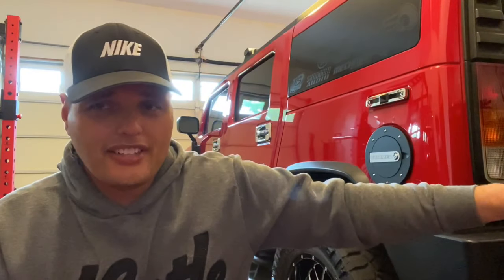I'm going to explain the process in two separate ways. The first is if you have a factory front stage — your door speakers and pillars — with an amplified subwoofer in the back, but everything else is stock. The second is my setup, where everything is amplified: my front stage with tweeters and mids, and my rear stage with subwoofers. First scenario: you have a stock stereo but added a sub and an amp — that's what most people start out doing.